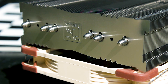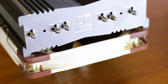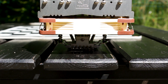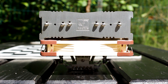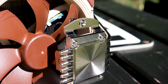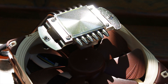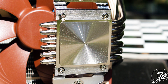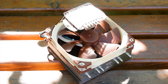The endings of the heatpipes are not covered by anything; however, Noctua decided to have them evenly machined so they match the rest of the cooler. Having the endings look even will not affect cooling performance in the slightest, but it speaks volumes about the build quality and attention to detail offered by Noctua. The base plate is made from solid copper, which is then nickel-plated just like the heatpipes, and its surface features a sunburst pattern most visible when direct light hits it — a cosmetic feature with no impact on performance.